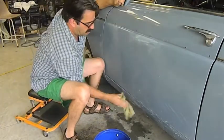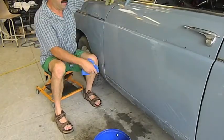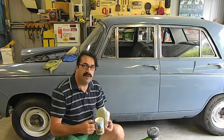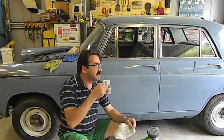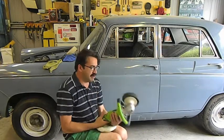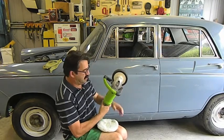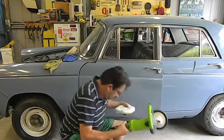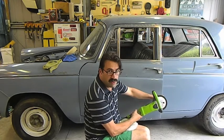Once I've wiped it off like this, I use a dry polishing cloth to take any residue off and have a good look to make sure I've got rid of all the pits and lands and it's nice and flat. Now this is a variable speed buffer. Stamped on the top is direction and rotation, and that must be adhered to — you must always be thinking about the direction the thing's turning while you're buffing. For example, if you're buffing down a door you want to buff off the edge of that corner, because if you buff into it you're going to burn through the paint.